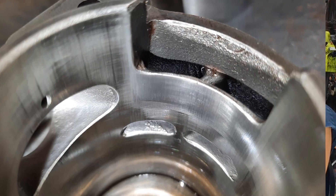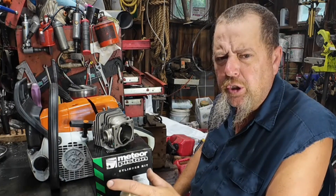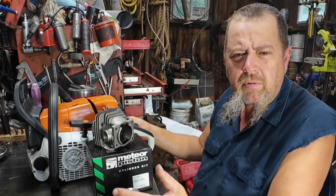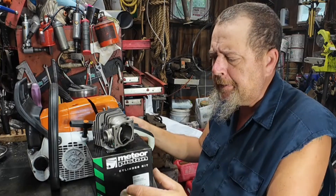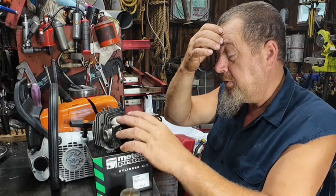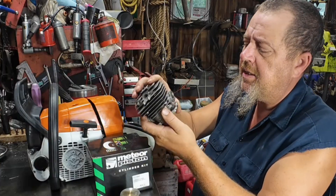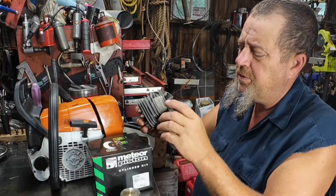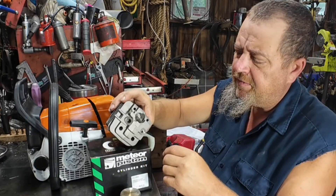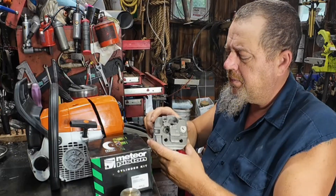This one still had a little bit of rough casting inside the transfers — not enough to hurt, just kind of bubbly. Donnie Walker calls them grapes or something like that. I always try to find something wrong with everything, but I also try to offer a fix. I think with a long burr mill or a 90-degree handpiece you can do a little bit of tweaking on them. The intake and exhaust are finished nice, transfers look good, combustion chamber looks nice, and the threads are good — I've had aftermarket cylinders where it looks like they threaded them with a hatchet.